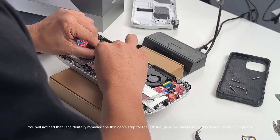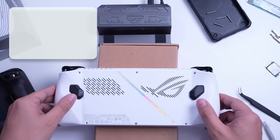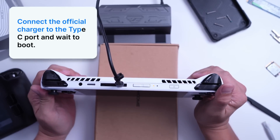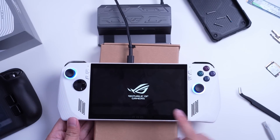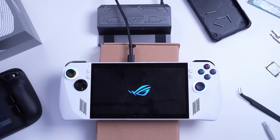Once you've replaced the old SSD with the new one, return the back flap, reconnect the two battery pins, replace the back panel, and re-screw everything. Before you turn on your ROG Ally with the new SSD, get the official charger, connect it to a power outlet, and insert the Type-C end into the ROG Ally without pressing anything. If the light at the top doesn't turn red or white, that means something went wrong and you may need to reconnect the pins. If it doesn't boot, you can then manually press the power button. It should boot the ROG Ally, and that's it — you now have upgraded storage.